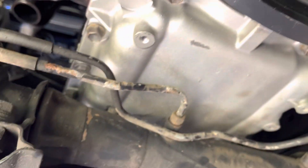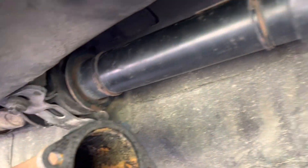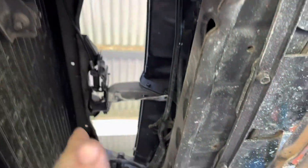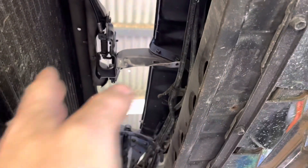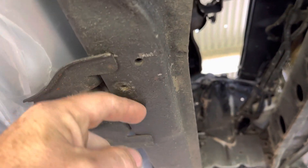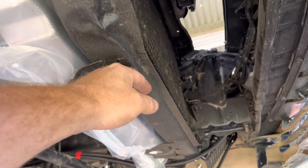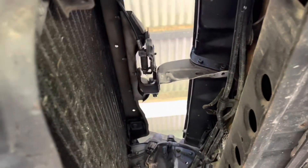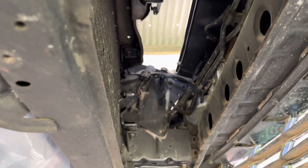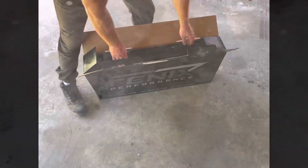Our main goal here is to get the motor in and get all the parts fabbed up so it all goes together. Let's get this intercooler bracket made. We're going to get the intercooler up in this gap here - it's a huge gap - the intercooler is not even 100mm wide, so it's three inch but not 100mm wide. We're going to get something off this radiator support to hold it, then make some nice alloy brackets for the top and use some flat bar down here.